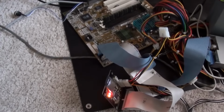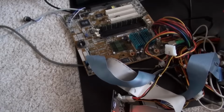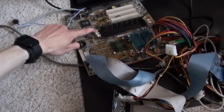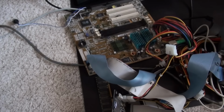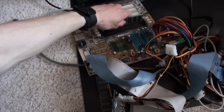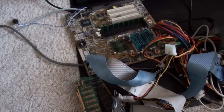We're definitely on. Like, that's going. I don't have anything on the screen. Hey, buddy, pal, motherboard, why aren't you working? That could be a bad RAM or wrong RAM, so let's force power this off. Now, normally you should exercise better discipline with these kind of things. That's 512. Sounds pretty good. It'll probably make it crash or something. Alright, let's try it again.